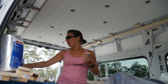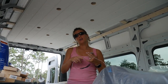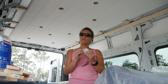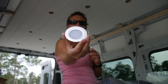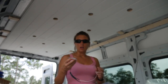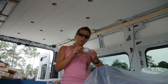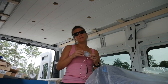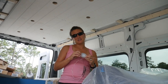I just got done sanding the ceiling. We are going to paint the ceiling a beautiful shade of white, and after that's done drying, we are going to put our 12-volt LED lights in. These are awesome because they have two little arms to keep the light from falling out of the ceiling. Alan's got it all wired up and labeled — really time consuming; we've only done four so far. While the paint dries, we are going to put more sound deadening in the doors, the back, and the side, as well as some more insulation.